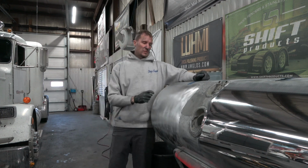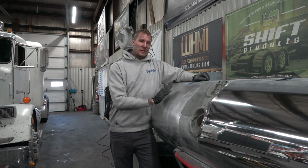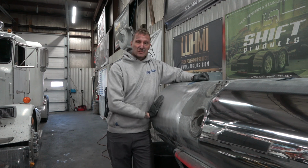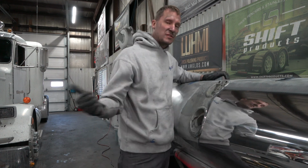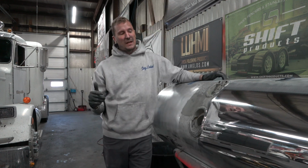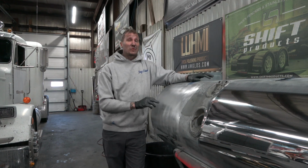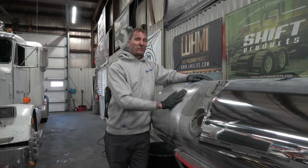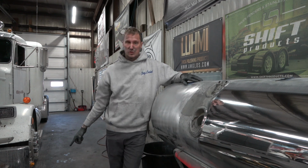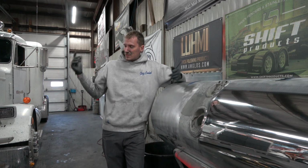So this side over here, all we did was sand 220, 320, 400 and got it as smooth as possible. This side over here, Nick sanded it. He's taking our advanced training course, and I had him sand out to 600, but I always prove to everybody that you can cut out from 400. So I'm going to show you guys the steps of once you get to 400 or 600, how to get to a show finish. It is literally, let's just walk through it real quick.